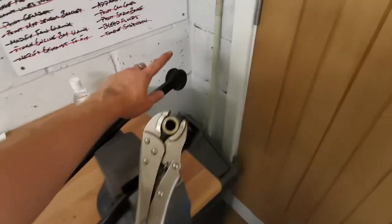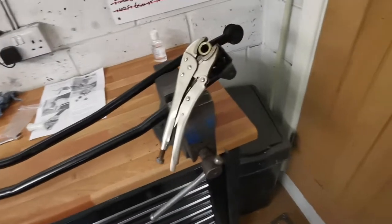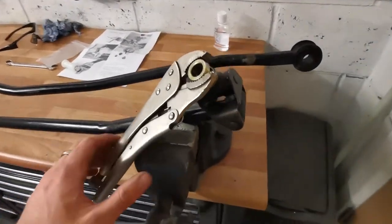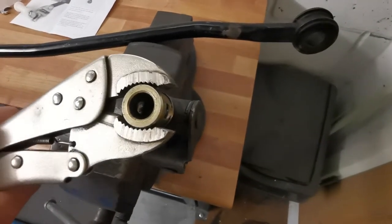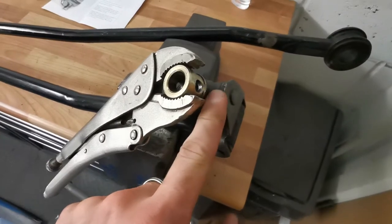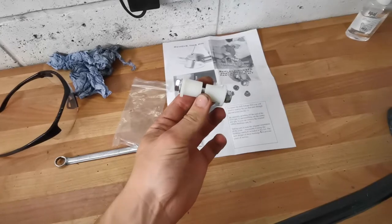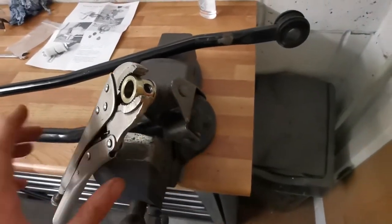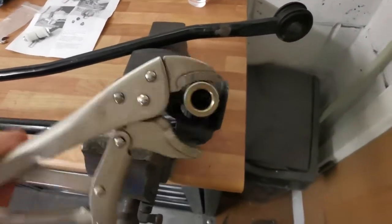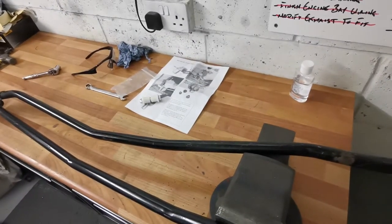The bushes on both sides have been changed, and obviously the shifter itself. The only thing left was the rivet joint at the end — you can see there's a fair bit of movement in that joint. Fortunately, Hasport sell a gear linkage repair kit. That involves drilling out the large rivet, taking the bushes out, and replacing them with new ones and a bolt.